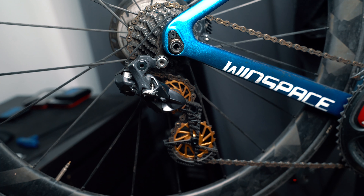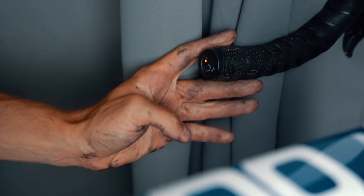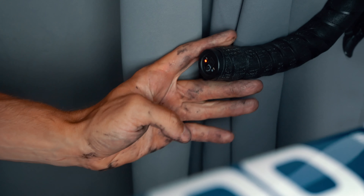The updated design is also easier to adjust on your derailleur. It's basically just tuning your regular derailleur — you may just need to turn the B-screw a little further than with the original Shimano one. You don't need expensive knowledge in bike mechanics to adjust your own oversize pulley wheel. And if you can't figure it out, just bring it to your local bike shop and they'll help you out.